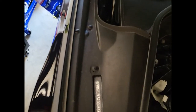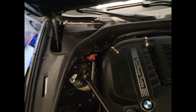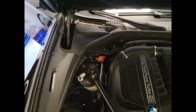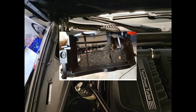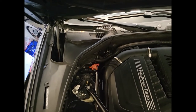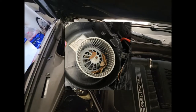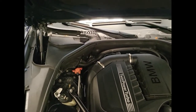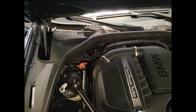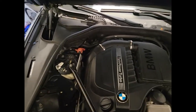See all those leaves there — they get in through different spots and end up getting stuck there. Over time, the problem is the mesh is made out of a material that just disintegrates, and you end up with all that debris going inside the actual blower. You'll notice it when you go inside the car, start the engine, and put your air conditioning or heater on — you'll hear constant humming that gets louder and louder as more stuff gets in there. If you ignore it, eventually the blower motor will blow.